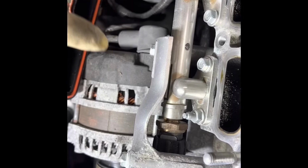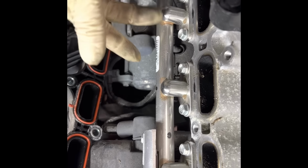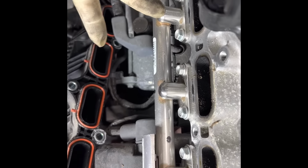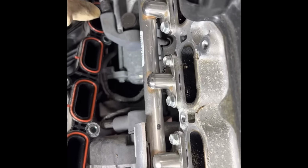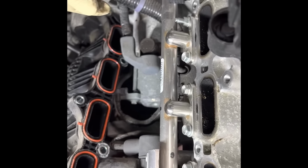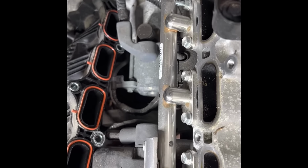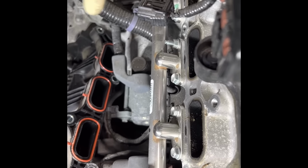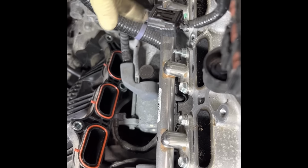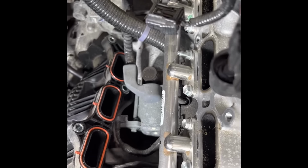Basically take this bracket. It's a 10mm, one right here and one on the top. And don't forget to disconnect the connector on the injector. After taking all the bolts and nuts out, you should be able to pry it out with a pry bar or any pry tool or flathead, whatever. Then make sure to disconnect this line too. It's a 19 wrench. Loosen this, leave it hanging. Then let's see. All right, follow me.